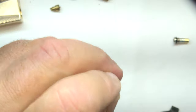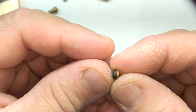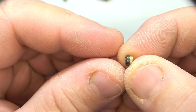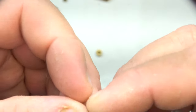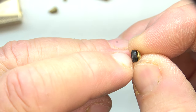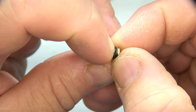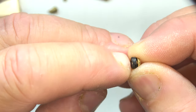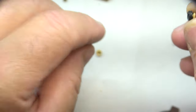Another thing I want to go over is these Zama main internal seals. This is the original one — see the original one had a little bit of brass sticking past the edge right here. Well, here's what happens when you put the newer seals on: you don't really get anything showing past there. Your rubber is actually sticking out past the brass. What I've done on these is trimmed off this first ring a little bit — sanded them down, cut them down — and put them on just so a little bit of that brass shows past the seal. I am working on getting another supplier of original-size seals, but that's still in process.